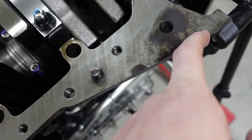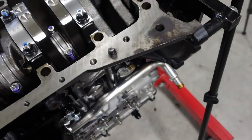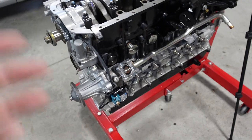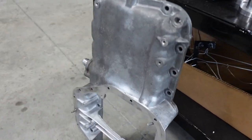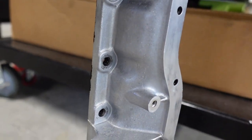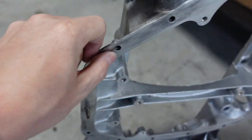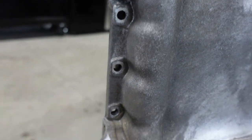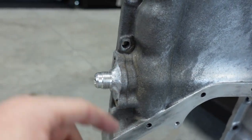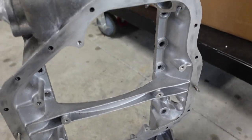The panel goes so far — that outside rusty area is where the pan doesn't touch the block. I might actually scuff that and paint it just so debris doesn't get in the engine. Speaking of that, the pan that came from Japan is crusty on the outside. Tom had scrubbed the inside clean. I need to get some of the old FIPG off with copper brushes. There's still corrosion on it — I want to find an aluminum brightener and cleaner to try and get all of that off.